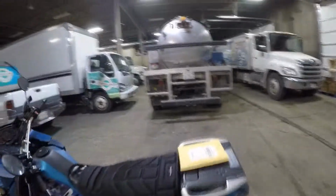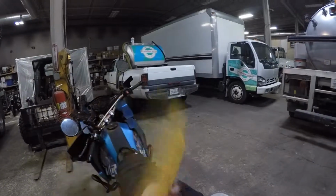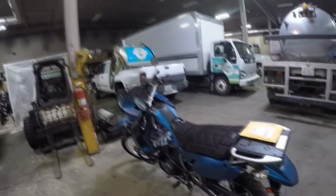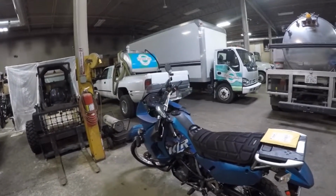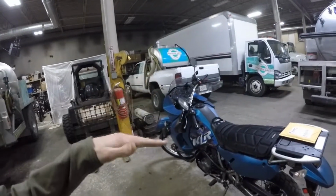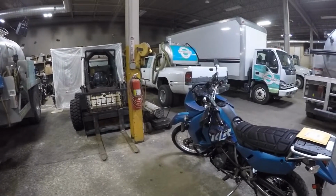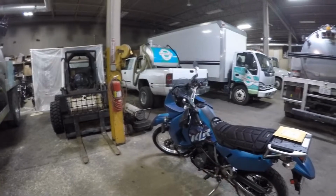So I went online, and these guys from Stead Engineering, they're out of Kansas City, Missouri, make a replacement nut, a brass nut that's going to go in place of the choke nut that's on the bike already. I know it seems like it has a vacuum leak because it's skipping. The bike will idle and it'll fluctuate just a slight hair up and down. So I'm going to run a propane test and see if I am getting any suction anywhere that it's not supposed to be, and see if the choke nut's at fault.